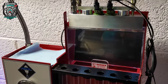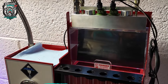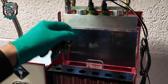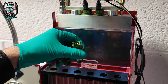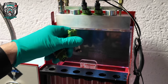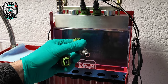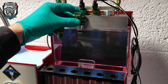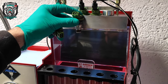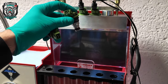You can see from that video why I think these injectors are bad. I've been servicing injectors for probably the best part of 20 years and I've never seen an injector with no atomization like this at all. That gives you a bit of background as to why I feel like there's an issue here.